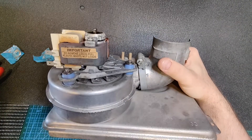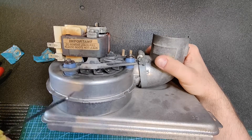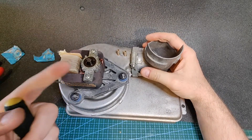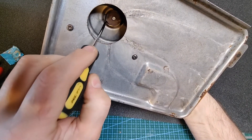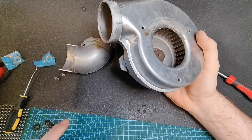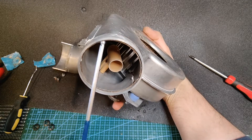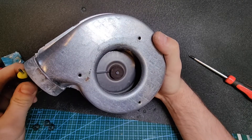The way this works is: you have the motor here, this here is like a cooling fan, and on the inside of the housing is the actual blower fan — so there are effectively two fan blades. That's what stops you from just lifting it up, so we need to bring the shaft out through the bearing and through the coupler here. This probably has an allen key on the shaft locking it on. If you look through here, you'll see there's actually a hole in one of the fan blades so you can sneak through an allen key — you want one that has a bit of length to it.